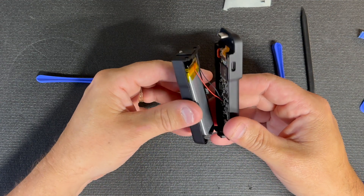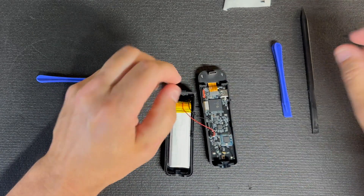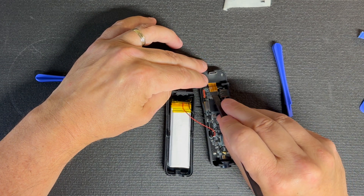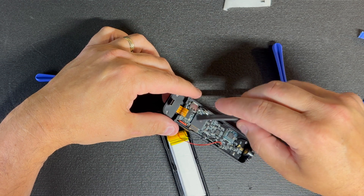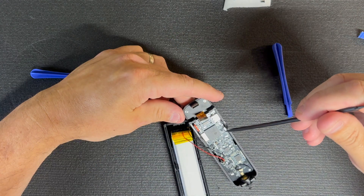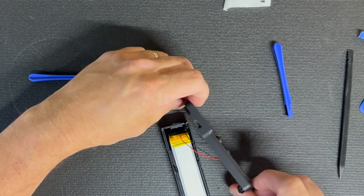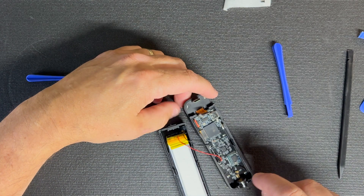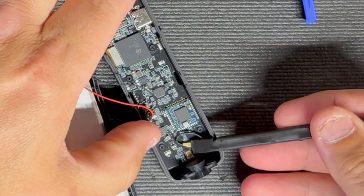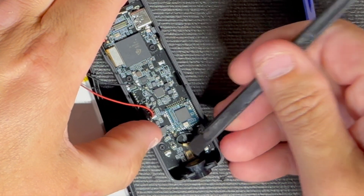Keep in mind you're dealing with a battery inside here as well, which is probably taped in. We do have a clip here to the USB — should be able to pop that loose. Just like on cell phones. Now I see three tiny Phillips screws. I need to get at the front side, right on the other side of that antenna. We can snap that antenna off gently with the edge of a plastic pry tool, especially since I haven't disconnected the battery.